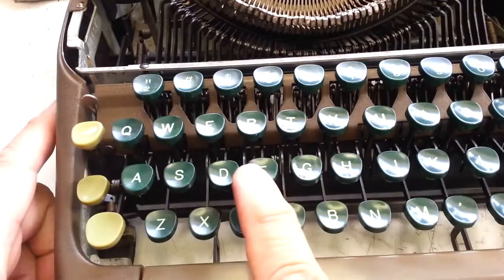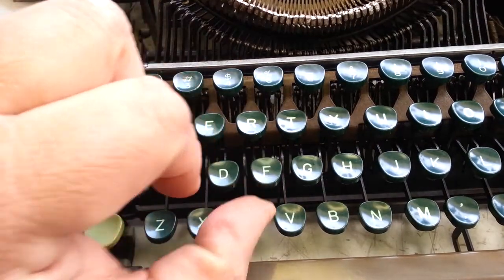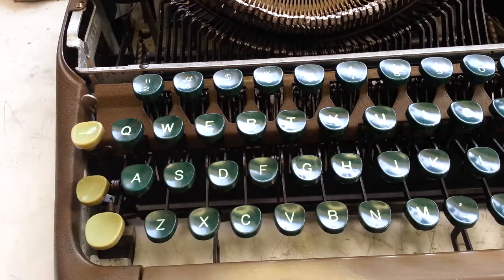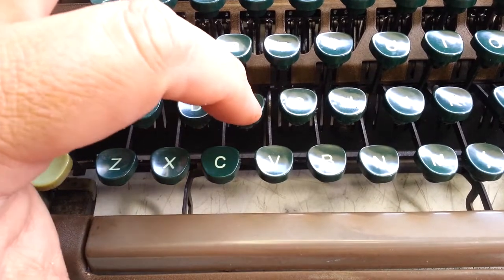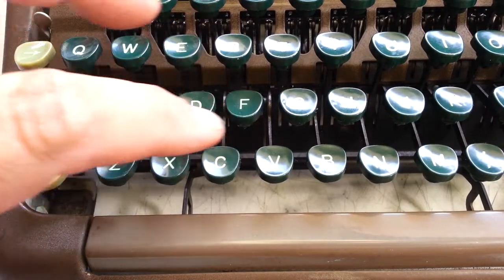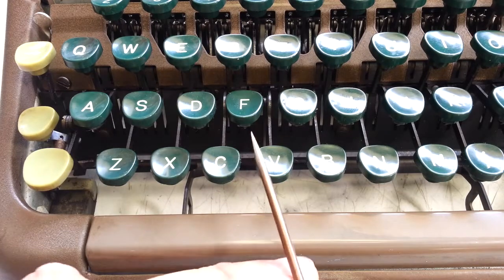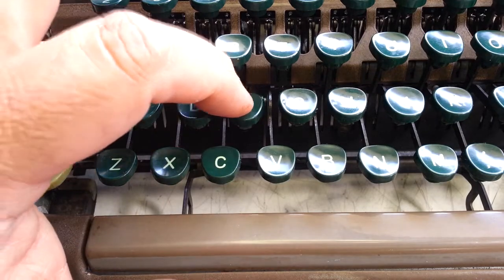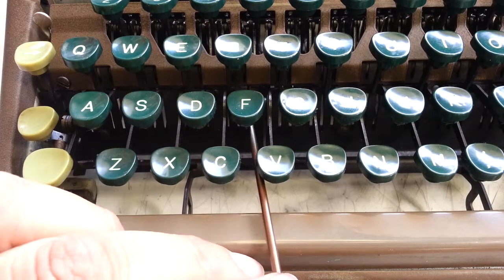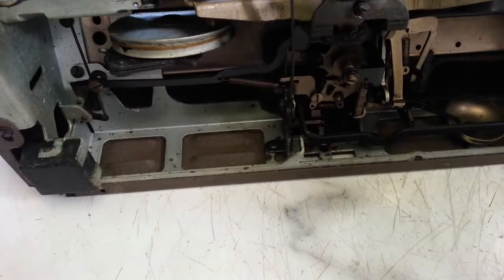What it is is the height of these key levers where they rest — it's too high. See this F right here, how it's lower now and it's going to fire off right away, no problem. But if it gets up a little higher — I'll raise it up — now it's stiff. What's happening is this pad underneath the typewriter.